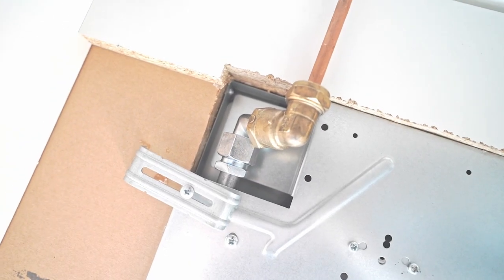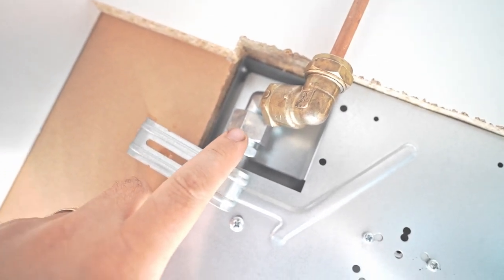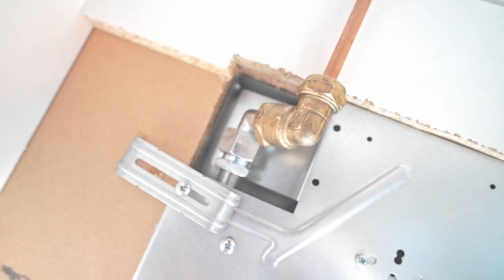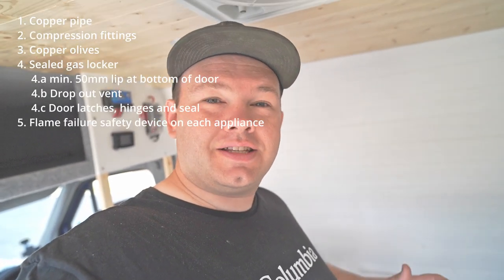Here it's all connected up — that is screwed into that fitting, that is screwed into this fitting, and that is compressed with that fitting. Before I forget: the appliances that you install have to have a gas cut-off on them. What I mean by that is, if the gas coming out of the appliance is not ignited after a certain amount of time — I think it's about five or ten seconds — the gas appliance will actually cut off the supply of gas automatically. This is a really important safety feature that your appliances absolutely must have in your camper van.